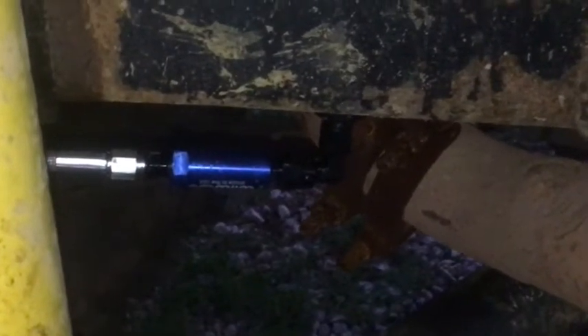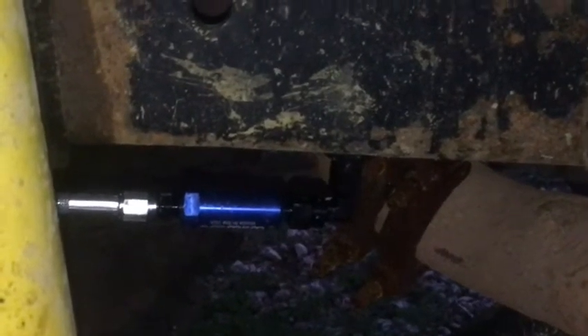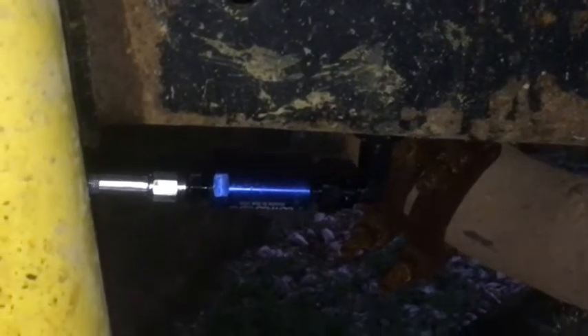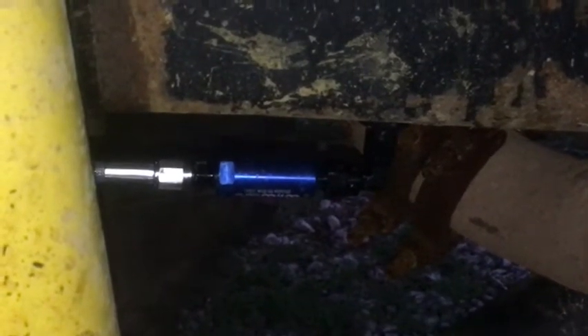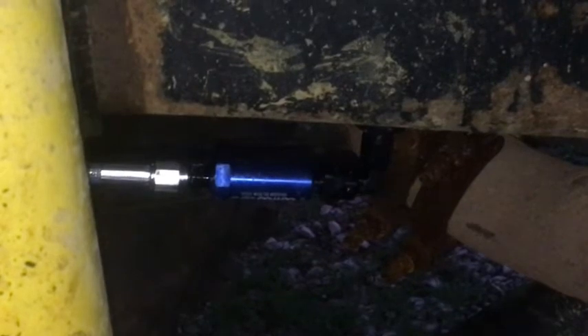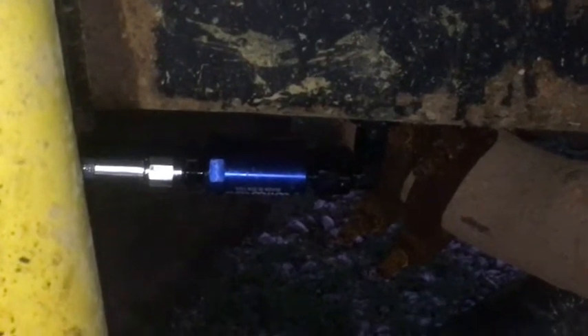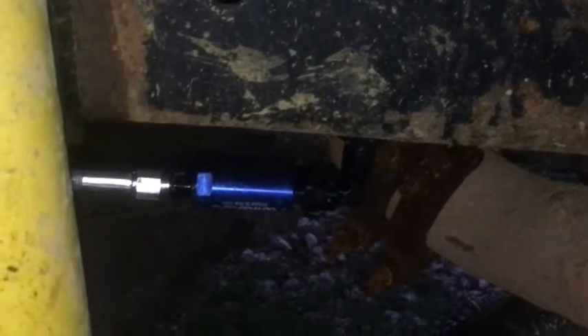This isn't the best place for this valve, but this was for testing purposes and it was easy to put in line here. That's a residual valve — a two-pound Wilwood residual valve. This is normally used when your master cylinder is lower than your brake calipers, like in a hot rod. My thinking was it could add just a little bit of preload to the calipers and give me back just a little bit of my pedal stroke. I installed it and it did help just a little bit, but I still am not getting the pedal I think I should. I have to travel probably halfway down before it gets firm.